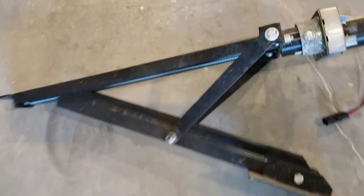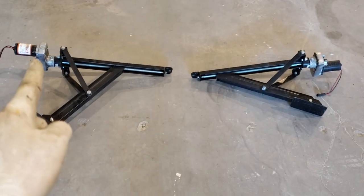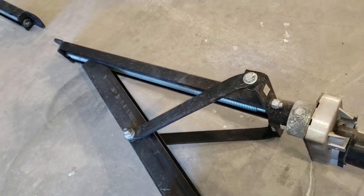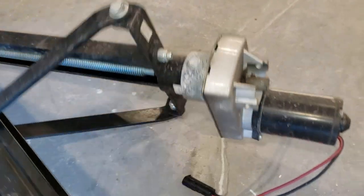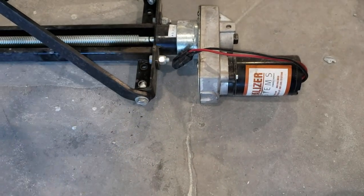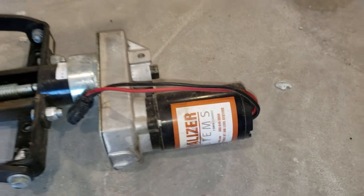Here are the electric jacks. Normally you see these things where there's one motor that goes all the way across and they work together. These have a great big Acme worm gear and a bolt that falls out — this is basically a slide-out motor. You see these on trailers all the time as a long worm gear slide-out motor. Even that gearbox right there is nearly identical — they just slapped the Equalizer system on it.